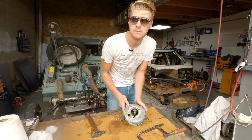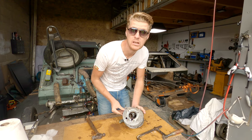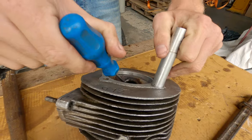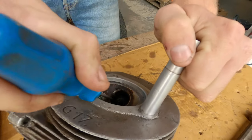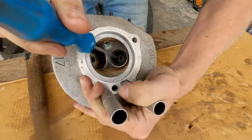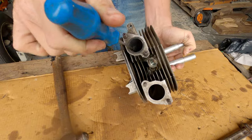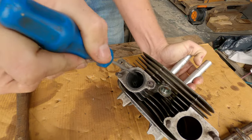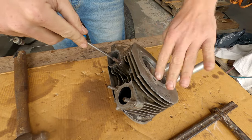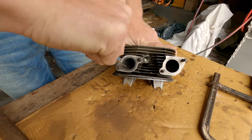And to do that, I'm going to get in there with a little bit of a screwdriver and scrape the loose stuff away. And then we're going to put it in the sonic cleaner. So you can see there's carbon buildup here. There's carbon buildup in the back there, which is a crucial point, because as gas flows out of your engine, it has to flow up that chamber there and out of here. And you can see there's also a lot of carbon buildup here. So I'm going to chip as much of that away as I can, gently, of course, and that then helps us later on.